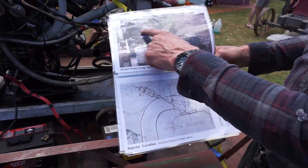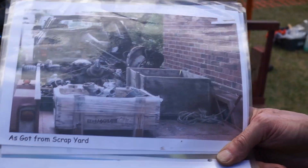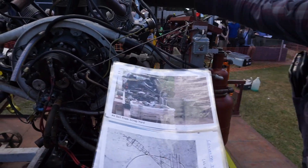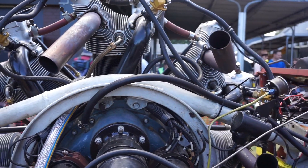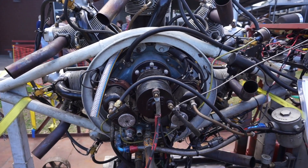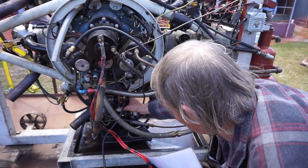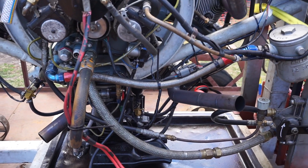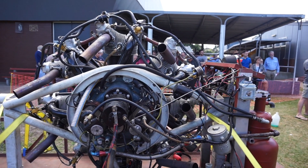Here's a picture of the engine — or boxes of bits and pieces that I got from the scrapyard. The secret with fuel injection is having the injector spraying into the inlet port. We've got these inlet pipes here which come from a central ring manifold, and I've put fuel injectors in the elbow, accurately positioned so they spray onto the back of the inlet valve. That gives a great advantage to a radial engine because normally the carburettor is down here and it has to suck the fuel up — the bottom cylinders get more petrol than the top ones, making them hard to start and run evenly. By putting the right quantity of fuel in the right place at the right time, it runs considerably better than the original.